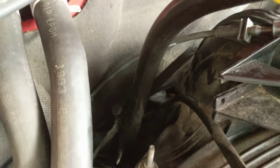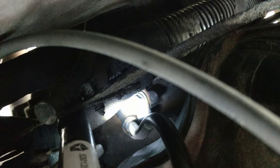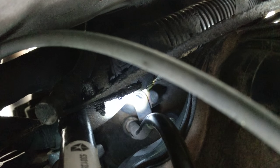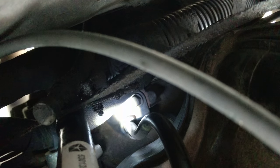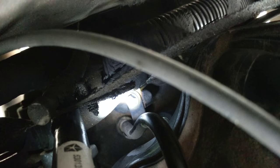It's gonna be very difficult to see this, but I'm following the oil dipstick tube — down in behind there you have to have a socket with an extension. There's a nut right there — you see that? Once you remove that nut, it should allow you to pull that dipstick completely out of there. It's a bear to get down to, but worth pulling off because this thing is rigid and gets in the way.